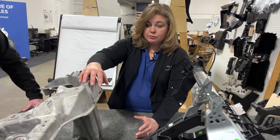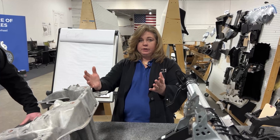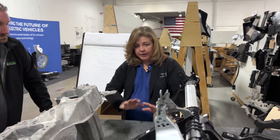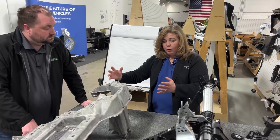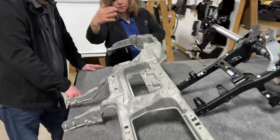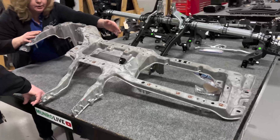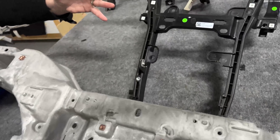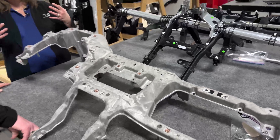In a crash, this is really critical — you need to be able to steer to avoid secondary impacts, and you need that steering wheel not to come at you. That rigidity is really critical. Keeping the firewall in place is really critical. And with respect to safety, the cross car beam holds your airbags — the holes you see are where the airbags tuck in. The steering column comes through here, and the hole up here not only mounts the glove box area but holds your passenger airbags so that when they deploy, they come and protect you.